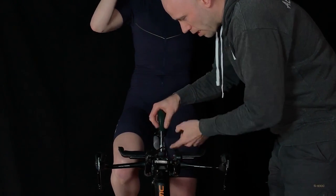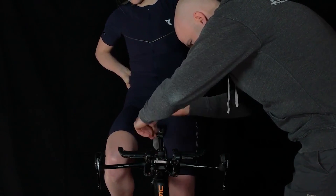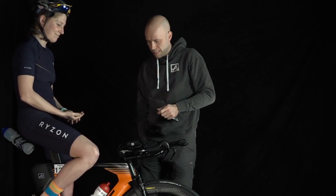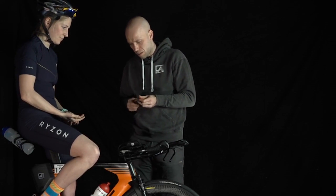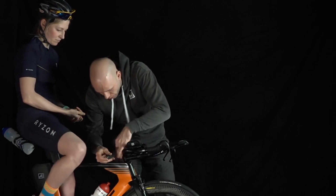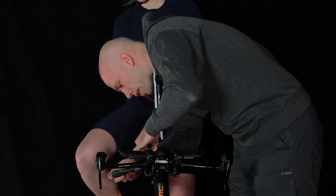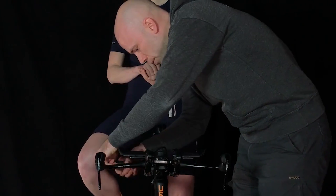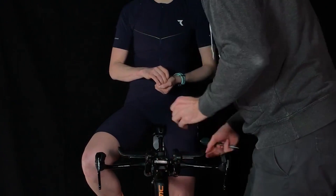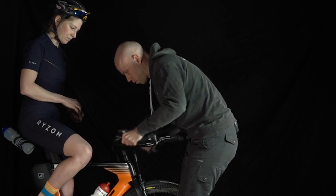I'm loosening the top bolt of the stem so I can open the stem upward. There is a small cover plate. Vicky, super, thank you — please hold for a moment. I'm switching to a different tool to continue unscrewing the stem. It is fastened with two bolts. For the video we won't tighten the screws completely — but when you do this yourself, you should make sure you do it correctly, meaning use a torque wrench to maintain the correct torque values. I've now loosened both bolts and I can remove the handlebar. Sometimes it's not so easy to loosen it — with a few rotating movements I can pull it upward.